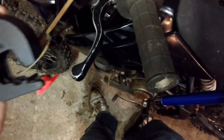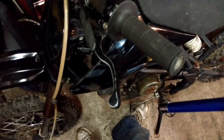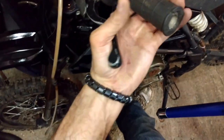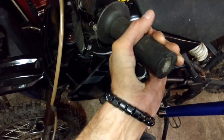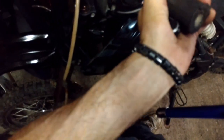Even after it breaks free, doing it this way is obviously a lot safer than trying to ride it out — heat up the engine and think that if you ride it around for a while it'll break free. If it's a street bike, that's a little sketchy. If it's a dirt bike, maybe — sure, if you've got good brakes and a wide open field, have at it. But if you've got a couple of days and you're working on other things on the bike anyway, you might as well put the clamp on the clutch and let it break itself free if it will. If not, you may actually have to get in there and physically break them all free, or it could be some other problem. But that's where I'd start first.